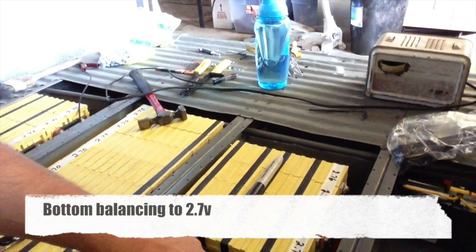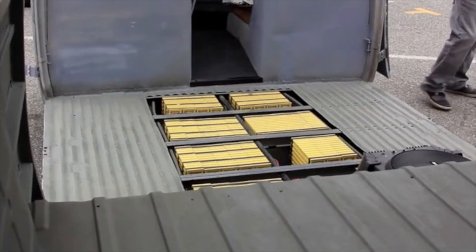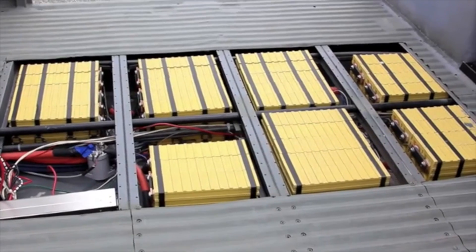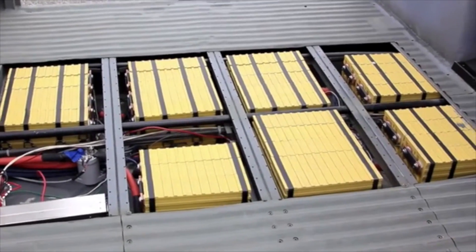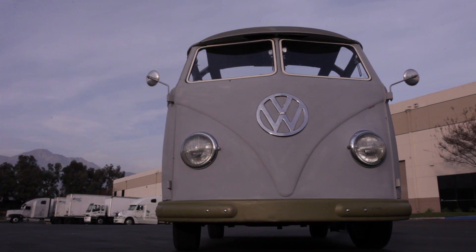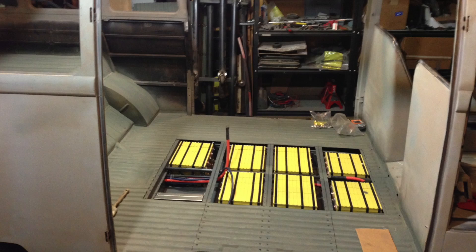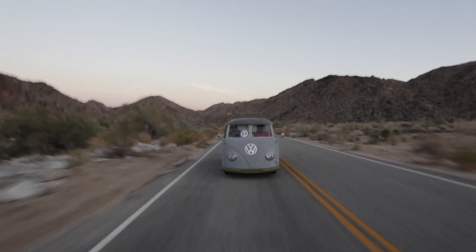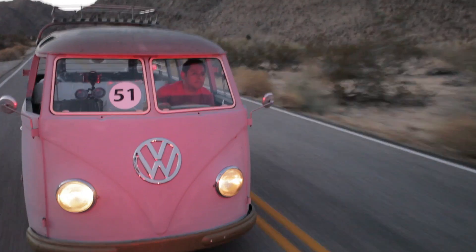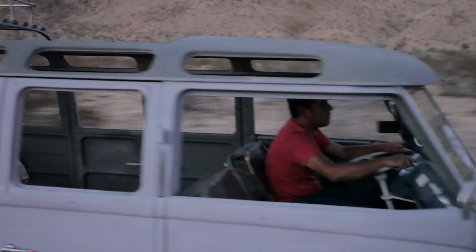This is the reason why I originally chose this type of cells for my Samba. The problem is that even though it's now considered old technology — first-generation lithium — it's still rather expensive, and the energy density is not the best at 90 to 110 Watt hours per kilogram. That means my 22 kWh battery comes in at 480 pounds and occupies all the area where the old gas tank used to be, plus most of the Samba's floor space. If I want to meet my 100 mile range target using lithium iron phosphate, I will have to spend roughly another $7,000 and get really creative finding space for all those additional cells.